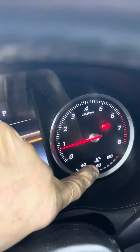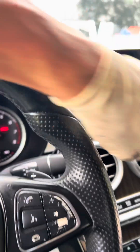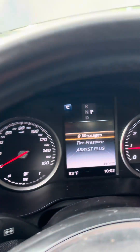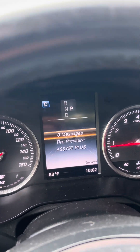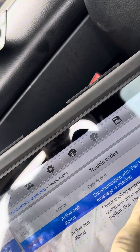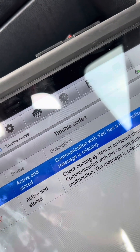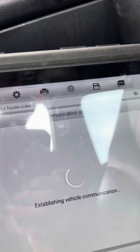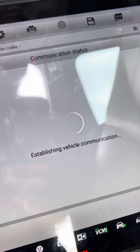Initially I had this symbol coming up. I'll turn the AC on and see if that changes anything, but it's not coming up now within messages. You hear the fan running constant. There's my fault codes again — communication — and then I had this message missing. The common denominator among these two components is a LIN bus — they're on a LIN bus circuit. I'll shut the key off. The fan is going to continue to run. I'm going to try to erase these faults, but they don't clear.